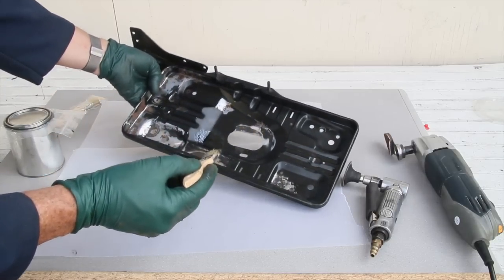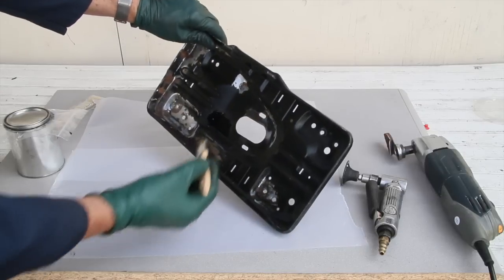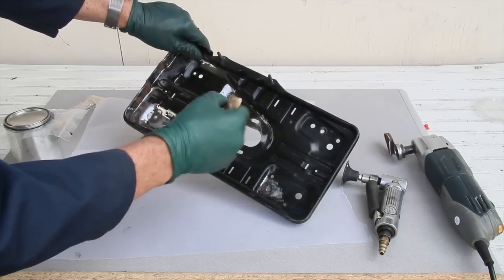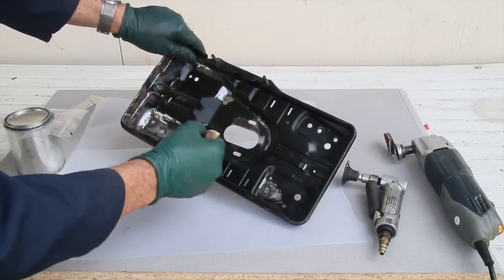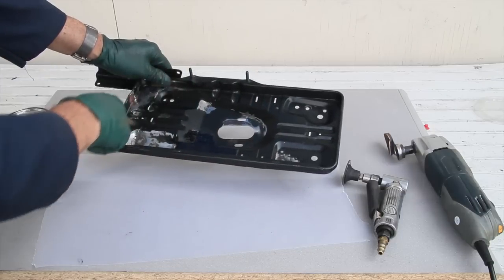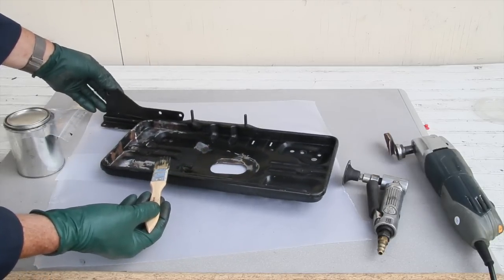Now I'll let that sit. It'll flatten out a little bit. Then I'll get another application of Miracle Paint and come in and do this area. You just lay it on. We sell the heavy-duty thick Miracle Paint, which doesn't tend to run. One of the things I don't like about POR-15 is it tends to run all over the place, and it doesn't adhere as well as Miracle Paint over the long haul. That's all I need to show you at this point — it'll take a few minutes to go around and do all these spots, then we'll do the areas inside the engine compartment and I'll come back and show you the final results before we reinstall the tray.